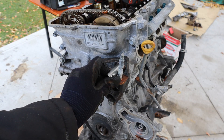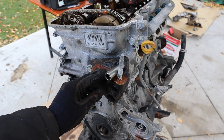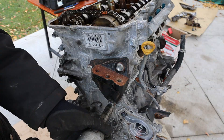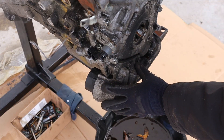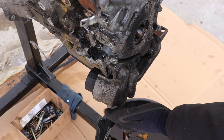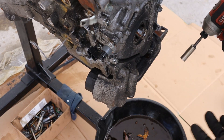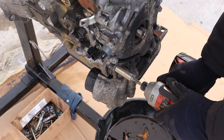To all you fellow technicians, I feel your pain — why couldn't they move this 3mm more so I could get the socket on there. This stud is an 8mm. I'm going to remove these bolts and that engine mount block. Here we've got the oil filter housing as well as the cartridge over here which is made of plastic. Back in the 2000s they used to make this out of metal but now they switched it over to plastic, which has a tendency to crack. I'm going to remove the 12s holding it onto the timing chain cover.